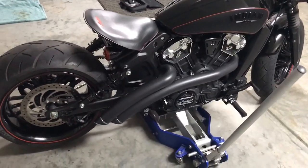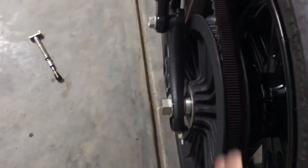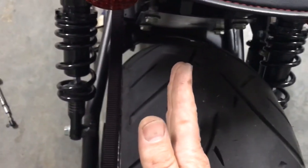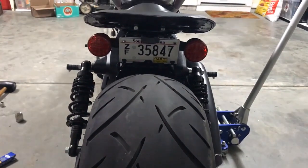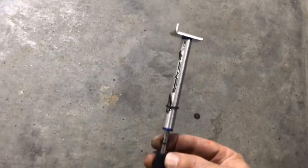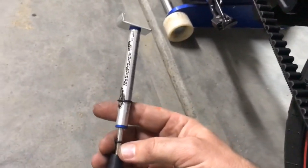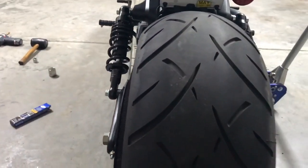At this point the install is complete. The only thing left is to adjust the belt tensioners — what they do is pull the wheel backwards, but as you tighten one side it pitches the wheel that way, and as you tighten the other side it pitches it the other way. YouTube user jfast has a really good video — I think he's putting a 180 tire on the rear of his Scout — and he shows how to line it up and use the belt tensioner. You don't have to use the belt tensioner gauge but it's a good tool — push it against the belt and it gives you a readout. What I've shown you was the hard part.